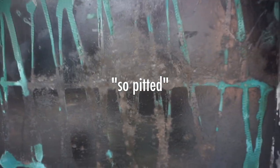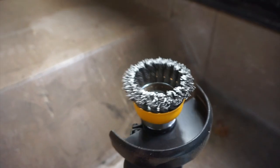When I took off these wall panels the other night, we found a little bit of surface rust. You can see it remains a tiny bit. So what we did was we took a wire brush and an angle grinder. We used a couple different tools, but this is the one that we ended up with. And we ground off all the rust just to be safe. And there was a little bit on these seams. And after that, we used this rust converter.